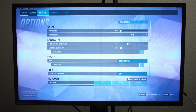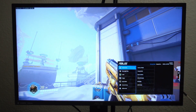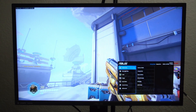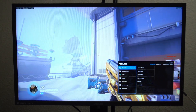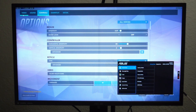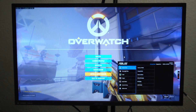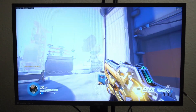Just to demonstrate this a bit more, we'll turn the frame cap down all the way to 67. Our frame rate is super low but still no tearing whatsoever. And there's an interesting thing happening where it is doubling — 67 doubled is around 134, and that's why it's currently at that refresh rate. It's kind of a low frequency compensation thing; they double your refresh rate instead of actually trying to sync it up perfectly when it goes below a certain threshold. So if we turn this up to 90, it syncs up perfectly. Boom — no tearing.